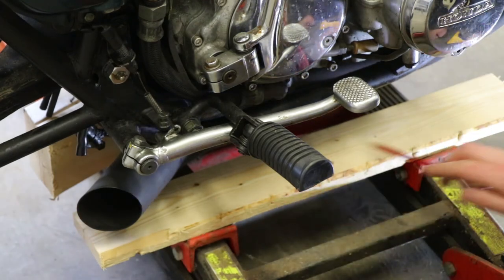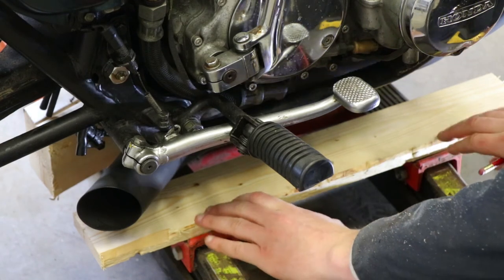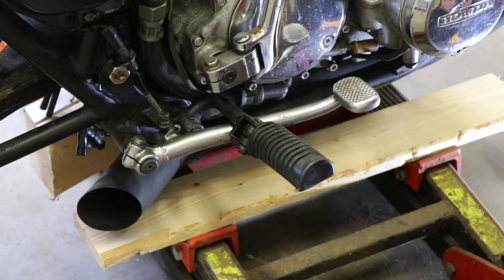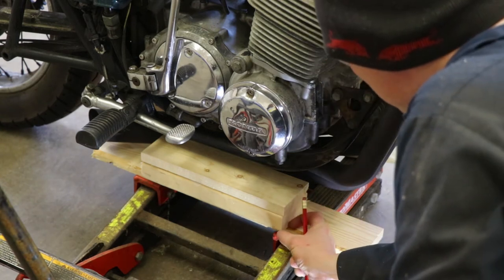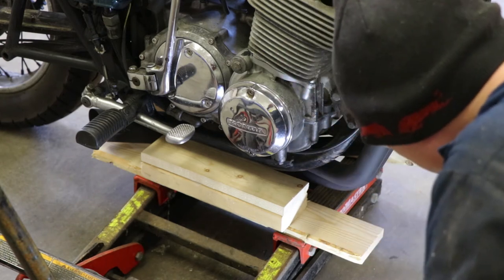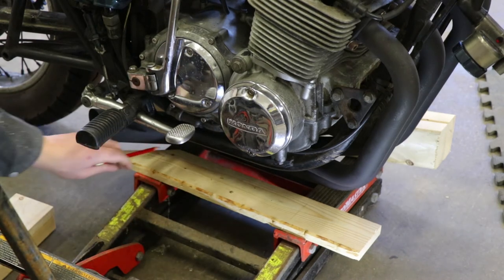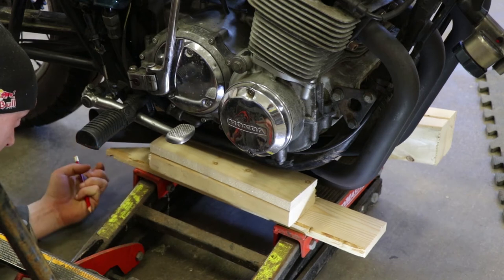Now I'm going to put a 2x4 here along with another piece of strapping. Ideally, I still want this 2x4 to sit over the jack here so that the weight is still properly on the jack. If we cut it too short in the middle, we could bow this and that would not end well. Let's try 12 inches. I think I'm actually going to hold these two pieces of wood about three-quarters of an inch out away from this board — the weight of the edges is still out over the actual legs of the jack, but I need this little bit of clearance for the pipes inside. I had to cut an angle back here in order to still clear this pipe. This is almost like playing with Lego. Really big kid Lego. Just keeping an eye on it all, making sure that it clears everything.